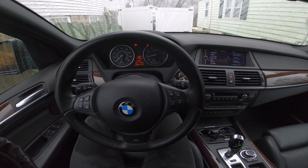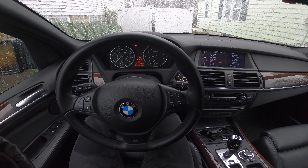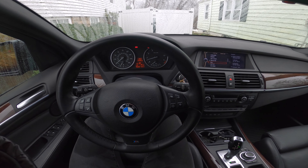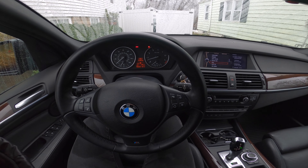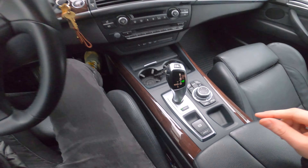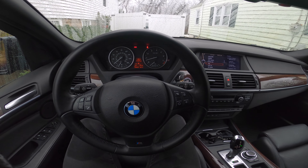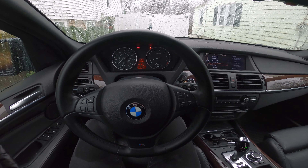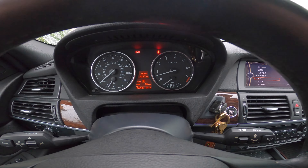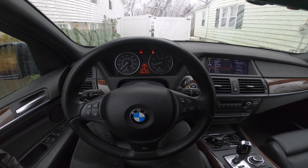I'm glad I did this test — it at least eliminated the alternator as being a potential problem making that noise. And the power steering, which is probably absurdly expensive for this car with the active suspension — here's the sport button; this is the model with the active or dynamic suspension option — yeah, so we've eliminated that. The next logical step would probably be to remove the air conditioner belt and see if there's any noise coming from the AC compressor.